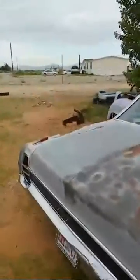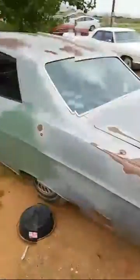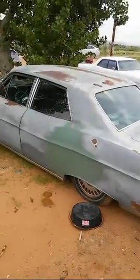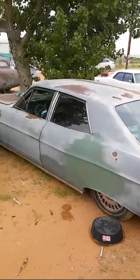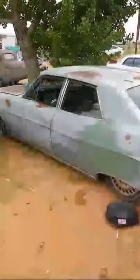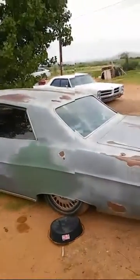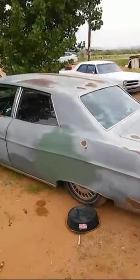It was just because we just tacked it from the sides in the middle, but when the car was lifted, it just flexed it. So we didn't put a solid weld on that or anything, because we never thought it was gonna happen. But when we were switching the engine and the suspension, we had to lift it a lot, and I guess we dropped it wrong where it flexed the body and it just moved everything. But that's no biggie.